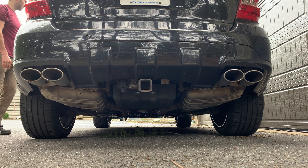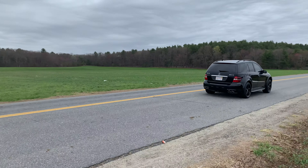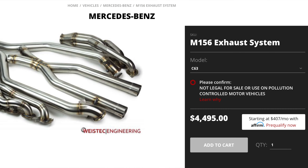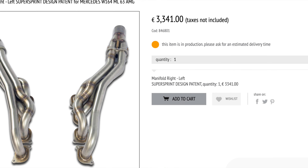It gives you a little bit of an increase in volume — some people say around 10%, maybe a little more after the exhaust breaks in over six months with all the heat cycles. It also gives a more aggressive tone, so you'll hear a little rasp and maybe crackles and pops that weren't there before. My favorite part is that it's still super quiet when you're not stepping on the gas — at 1,500 to 3,000 RPMs in normal driving you won't hear it, but step on it and it sounds probably more like a stock C63 AMG.